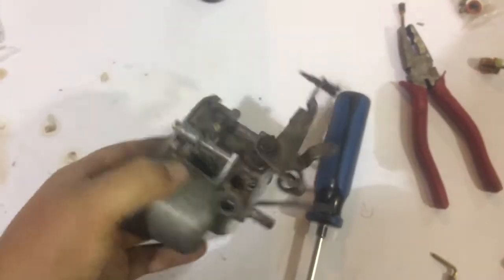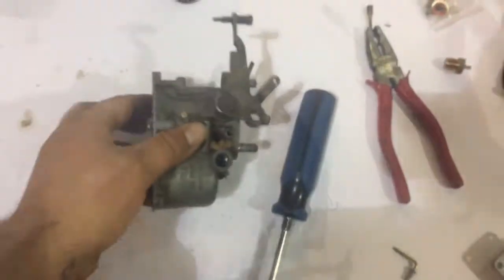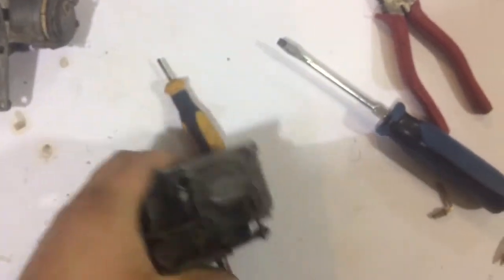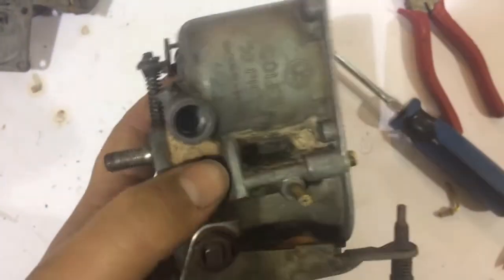About to put it back together. All these bits just go back together nicely. Got that diaphragm back in. I had to make a custom screwdriver because I didn't have a small one — this was broken at some point in its life and became a flathead. Time to put all the jets and everything back in. I didn't clean that corrosion off, but it gives it character. One thing I forgot that was really important: when you go to take out your fuel-to-air mixture screw, count how many turns you turn it out and write it down. That way you can put it back the same. It may still take some adjusting afterwards, but at least you've got a good place to start close to where it was originally.